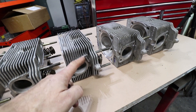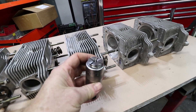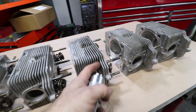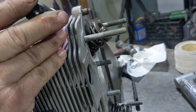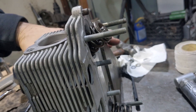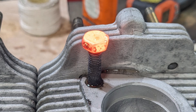One of the difficulties on doing this on the exhaust side is that I have the big stud remover that is a collet type, but you can't fit it on there because the fins are right there in the way. So I ended up having to use my welder and put nuts on the end — weld them on — because the double nut method is not strong enough to take the studs out. I had to weld the nut onto the stud just to be able to put torque on it.